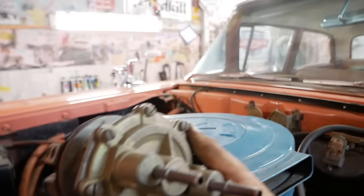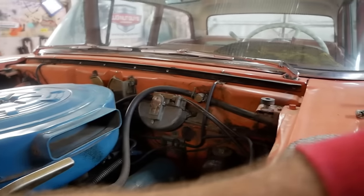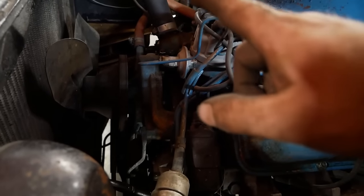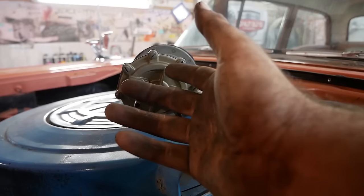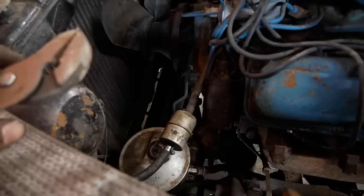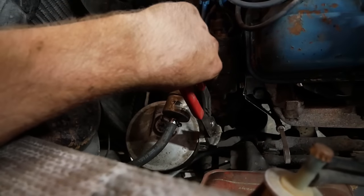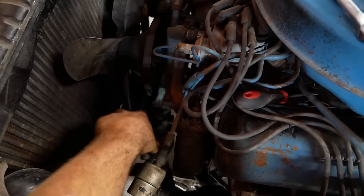I'll still ignore the brakes and let's change the fuel pump. This is a replacement fuel pump from the 1960s for this car. You see this on top — that runs the windshield wipers. This car has vacuum windshield wipers and you can't buy these anymore; well you can but they're like $300. We'll pull the old one off and keep it — I'll come up with a rebuild kit someday. These are totally rebuildable, you just unscrew them, change the diaphragm and spring and you're good. This is not going to be any fun to put back on — very hard to get to the bolts. The car has optional power steering and all this stuff is right in the way, so I had to pull the power steering pump off to get this out.